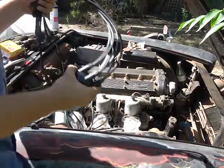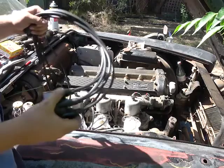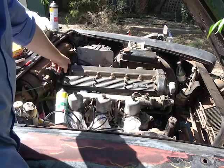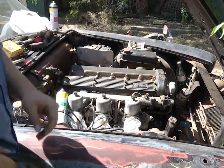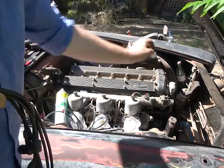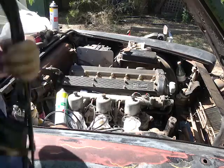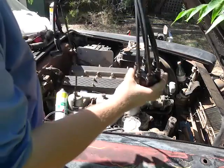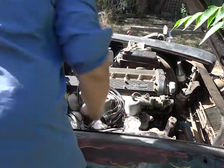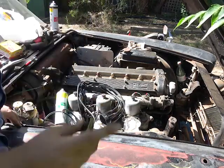When you're plumbing all this, 153624 is the ignition sequence on pretty much every 6-cylinder motor. But what you've got to remember is that's number 1 cylinder and that's number 6 cylinder. It's back to front on a Jaguar, unlike everything else, which makes that cylinder number 1 and that cylinder number 6. And the distributor turns counterclockwise in this application. So when you're plumbing it, it's 153624. I think Chrysler's turn the same way, like the Hemi 6s, but I can't really remember. It doesn't matter. Actually, it does matter.